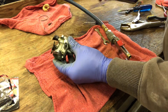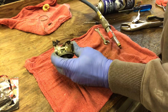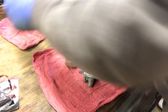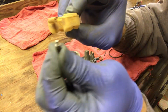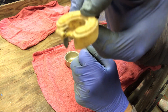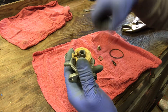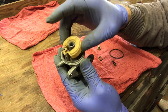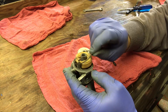Make sure everything moves freely. Spray a bit into all the holes. So you get your needle, get your float, and slide the needle into the float so it hangs like that. We're gonna set the float down into the carburetor, then get the pin and slide it in. This should move freely - it shouldn't be stuck. It moves nice and free, so that should be good.